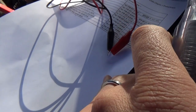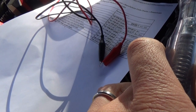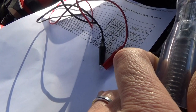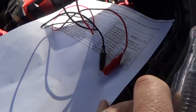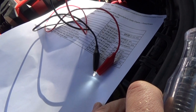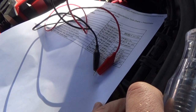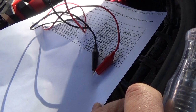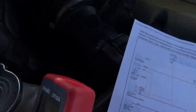Grounding it out for three seconds — let's see if it starts flashing. We get a code of four flashes. Then for each code you do the same procedure. Next code: we count twenty-four flashes. So we have code 4 and code 24. Let's write those down.